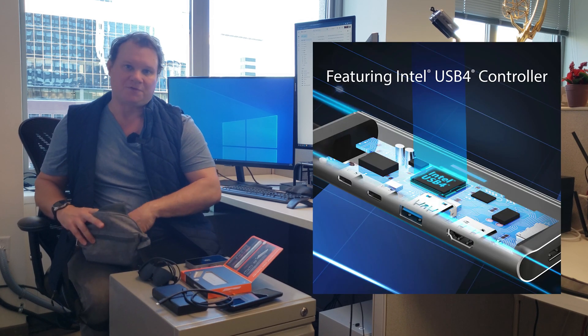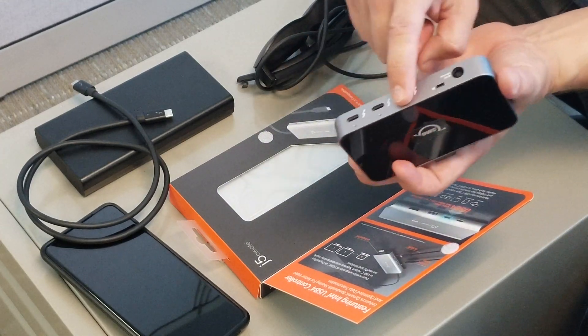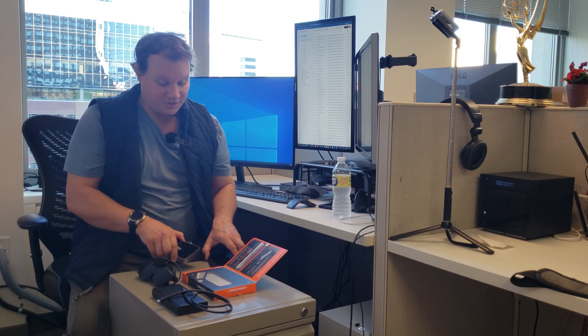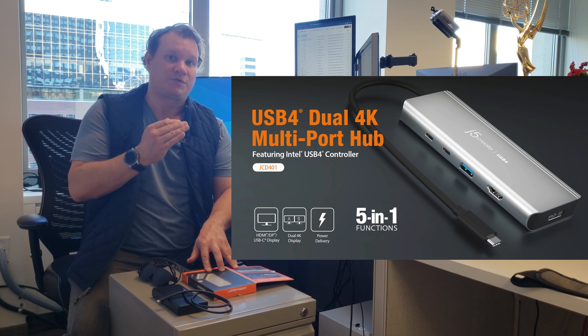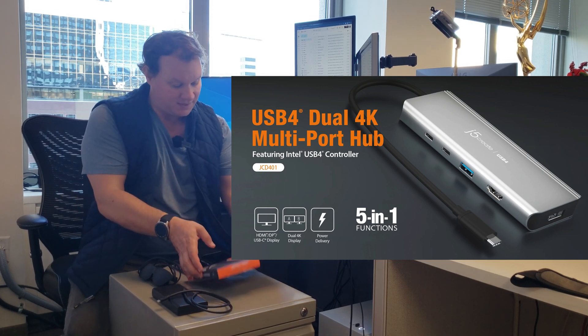The exciting thing about this is it's a USB 4 hub. What's special about USB 4 is that Thunderbolt 4 covers the USB 4 specification. Because it covers that specification, in a hub like this where you've got one host port and three Thunderbolt USB-C ports, you can get a video signal out of any of those three — so the DisplayPort will pass through even from your phone to your nreal glasses. USB 4 is backwards compatible with older versions of USB-C where it can take the DisplayPort alt mode video and pass it through to a downstream port.